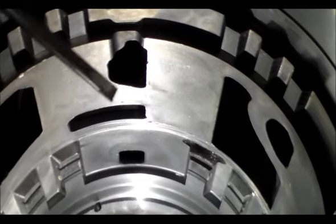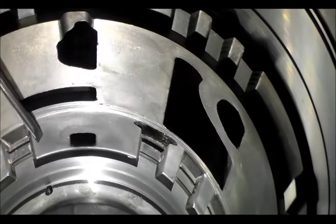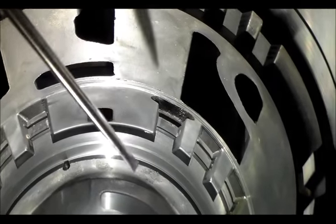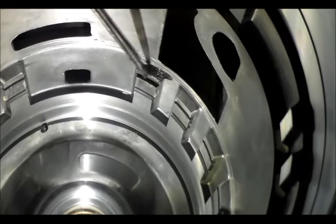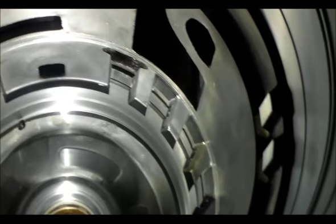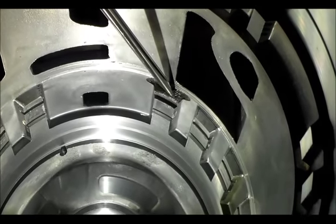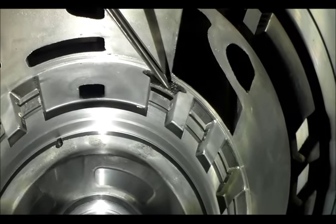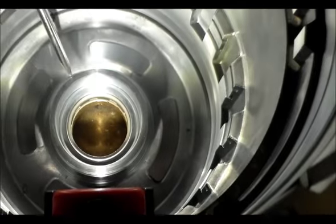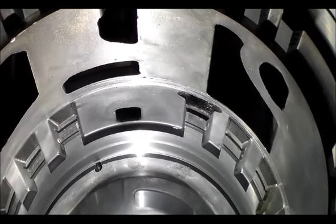Here's the shot of the case — the lug should go right here, and that broke off. Here's the space I was talking about, and normally this other lug breaks off as well. If they're both broken, you definitely need a new case. Being that one's broken, and given how this truck is used, I'm not taking any chances and I am replacing the case. When line pressure gets out of control for reverse, it could get up to — from the tech I was speaking to — around 650 pounds, and it blows the snap ring out of the groove and blows the lugs out.